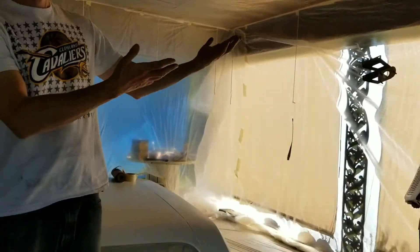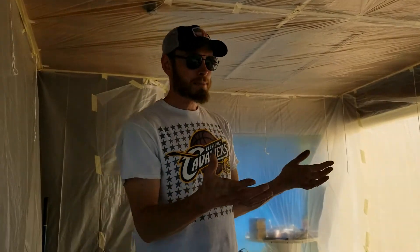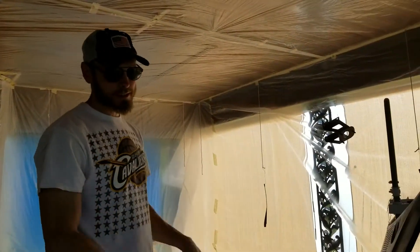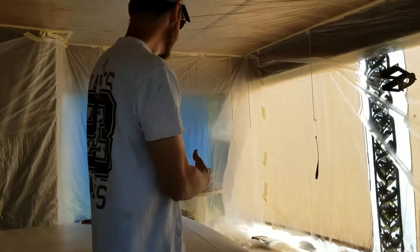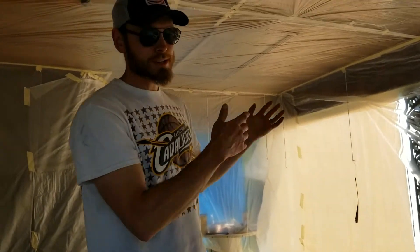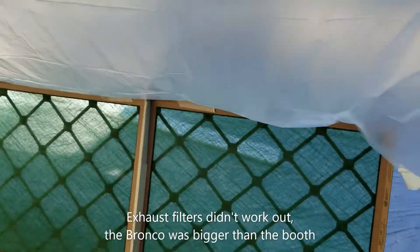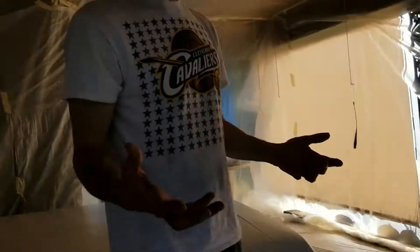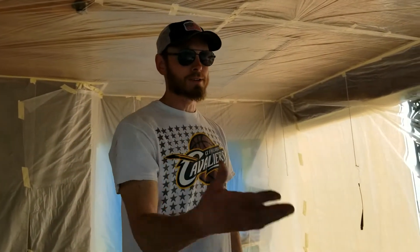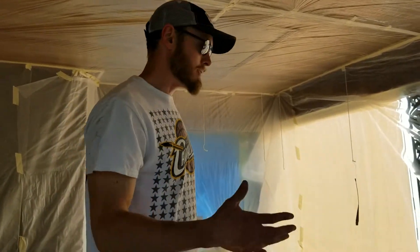Here we are in my dad's fortress of car stuff. I've made my paint booth in my carport using a lot of plastic tarping, sealed tight to the ceiling and floor. I'm going to make a filtration system — I've got two box fans on one side with filters, and a bunch of coarse hog hair filter material on the outside so I can catch some of the paint particles as they leave.